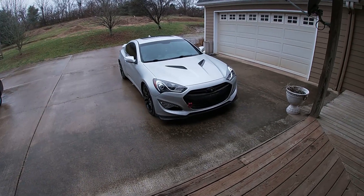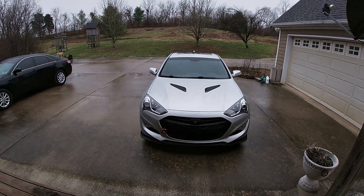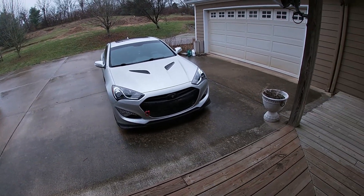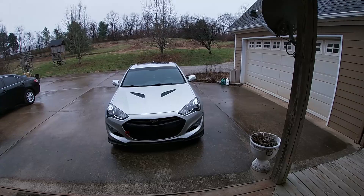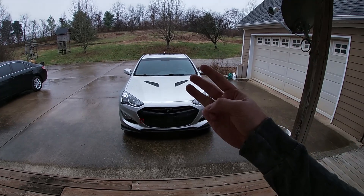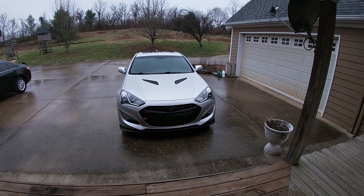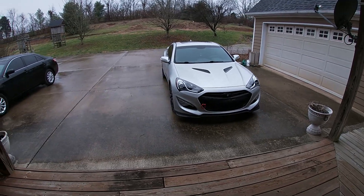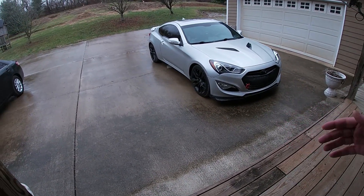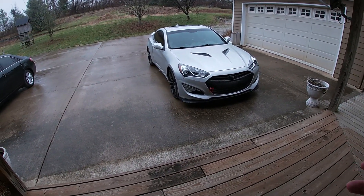It's a little bit later now and it's raining — the weather has taken a turn for the worst. As you guys just saw, the best time we could get for the 0 to 60 on my 2013 Genesis Coupe 3.8 was a 5.68 seconds. The best way to launch it from our experience: sport mode, traction control off, brake boosting at about 1700 RPMs, then not fully mashing the throttle off the line but easing into it. With better rear tires or about 20 degrees more temperature — around 60 degrees instead of 40 — that 5.6 would probably be a 5.3 or 5.4.